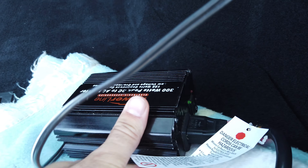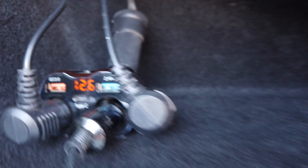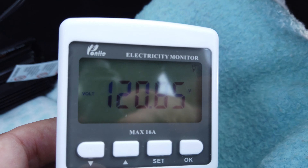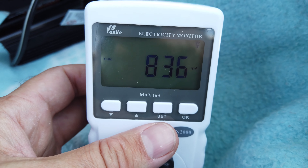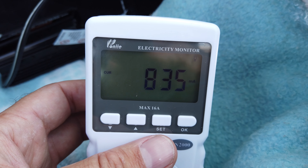This is being powered by an inverter — an old inverter I've had for many years — and then this is the cigarette lighter splitter that I installed. It's being powered by the car's deep cycle 12-volt battery up in the front of the car. The voltage right there on that battery is currently 12.6 volts, and going through the inverter that 12.6–12.7 volts is being translated to 120 volts, which is what it needs to be. It's pulling 840 milliamps — 834.